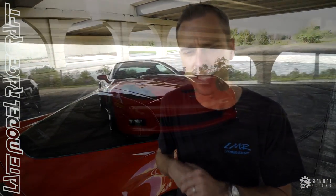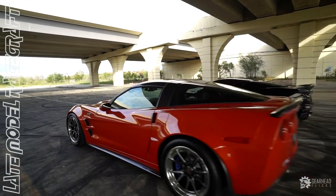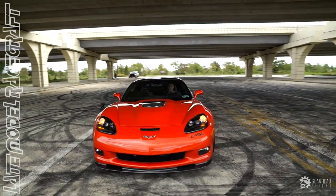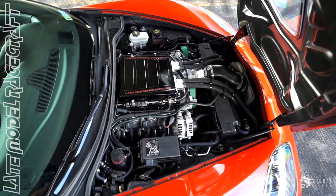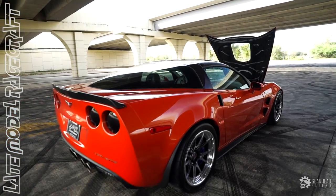Today we have a beautiful - doesn't look like it, but it's a 10-year-old C6 ZR1 Corvette behind me. It is Mr. Elephant's. He does live here in Houston, Texas. Been a good client of mine for the past 15 years. We actually built him a C6 ZR1 back in 2012 - our normal cold air, cam and headers. Little 700 rear wheel horsepower car. He got this one not too long ago - a beautiful Inferno Orange 2013, the 60th anniversary - and wanted to go with more than his 700 horsepower from back in the day. So we did our complete 1200 horsepower package: full build with a stock short block, complete heads cam, 2650 supercharger, and all the fuel and drivetrain upgrades.